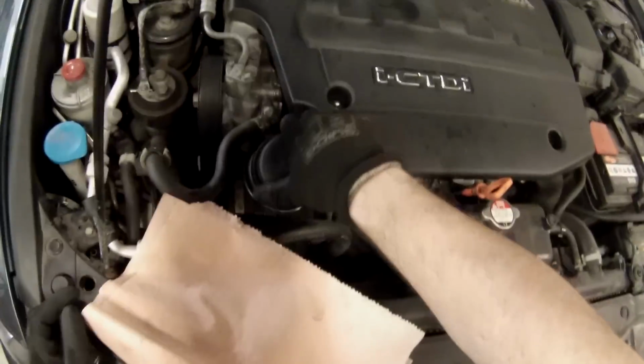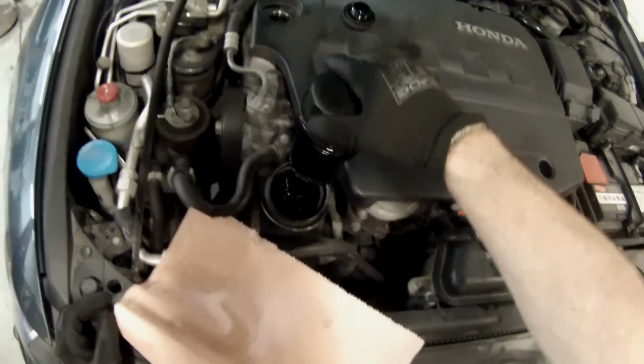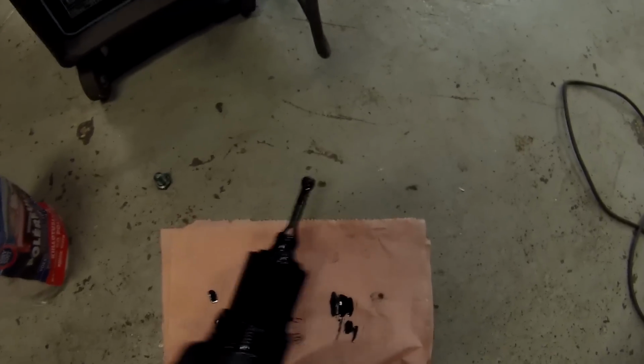Next up, but not last, is the oil filter change. So we already have unscrewed the cap, so we just need to remove it. And this can be pretty messy, so have a paper ready or some cloth. And here we got 3 O-rings that we need to remove. And it's great to have a flatheaded screwdriver to remove these O-rings.